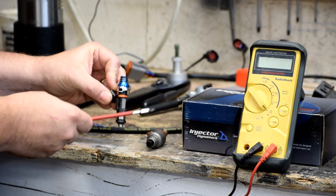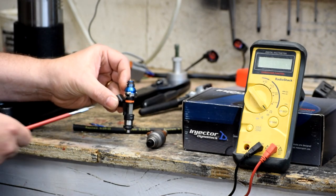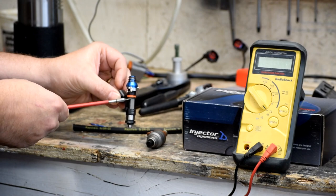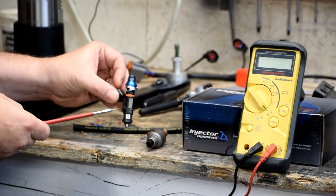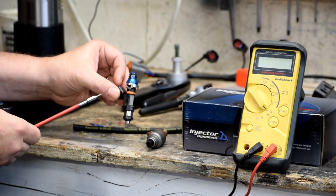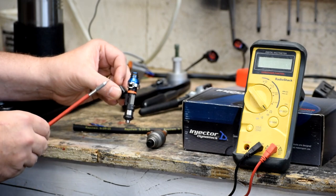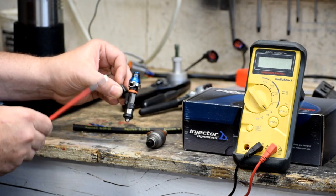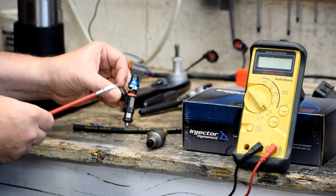This new injector uses a high impedance circuit, so you can use a simple control strategy with it. And most amazingly, because the internals are so light and performance is so good, this injector can control very, very short opening times much more accurately than the old one can. So you no longer need to make that choice between wide open power high flow and precise control for startup, warm up, idle, part throttle, and transitional throttle. Now you can have your cake and eat it too.